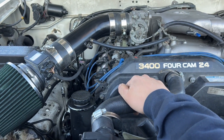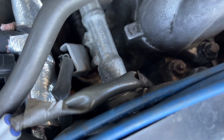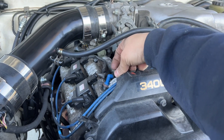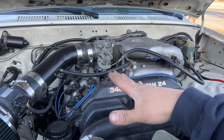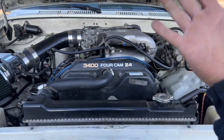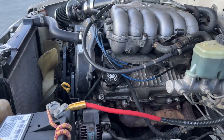The ECT I'm talking about is right here — this wire plugs into the sensor. Whenever I had that crank issue in the morning, I had to unplug it, start it up, it'll start and just bog out, and then as soon as I run back and plug it in, it starts to run normally. But again, even when it's fully warmed up, it still idles around 1100, which is not normal — and that's killing the gas mileage for sure.